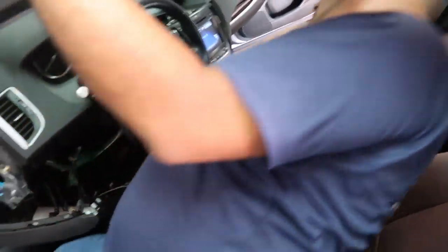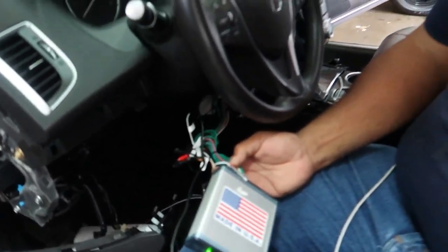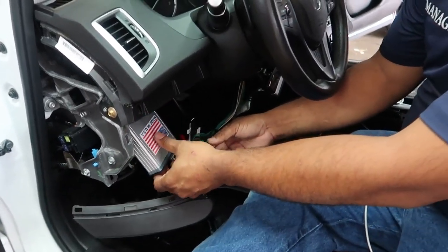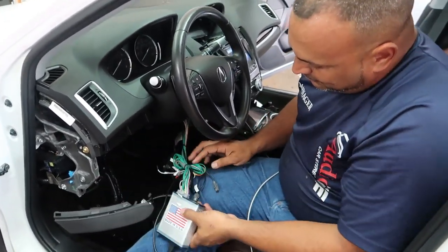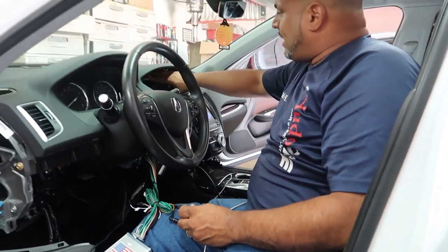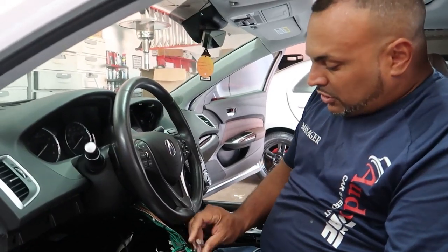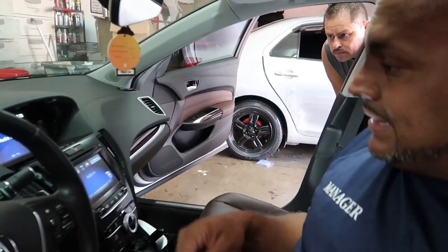So we're at the final part. I had to route all my wires — the USB extension to this corner. There's no area to mount it down on this side but I got everything good enough and I'm going to do some zip ties in a minute. Now we're about to do some testing to actually see if the Apple CarPlay works. This is your video in and video out of the top screen — right now she's completely blacked out. But if I plug these in, you'll start to see I get a signal source.